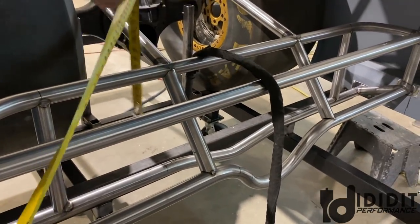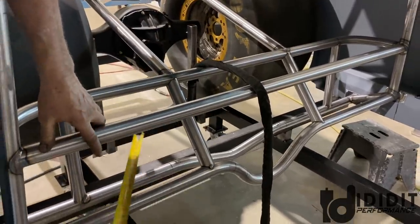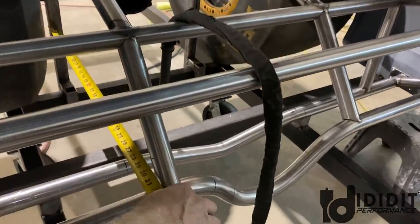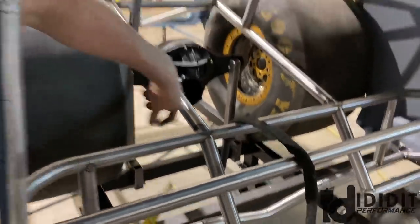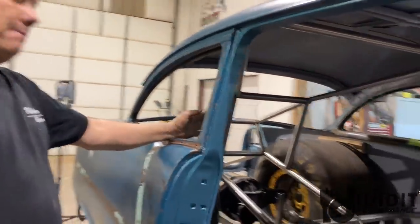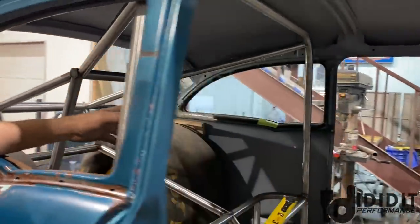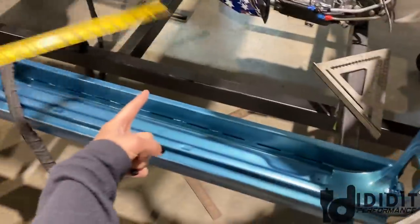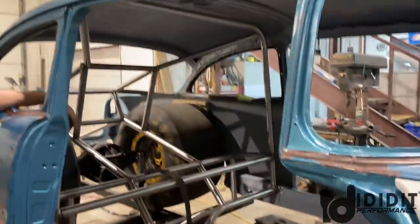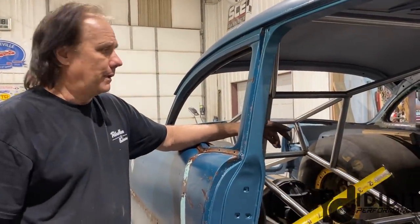There'll be a four link bracket right here. We're trying to keep our four links to around 22 inches, which, once you put the brackets on there and the brackets on the rear end, that bar center to center will be about 22 inches. We didn't want our roll cage back in the back seat like so many cars. Most cars that are built like this literally drive from the back seat. My pedals would be about here. Yeah, your pedals would be here. So we scooted our roll cage forward more like a traditional car, kind of like my Gasser.